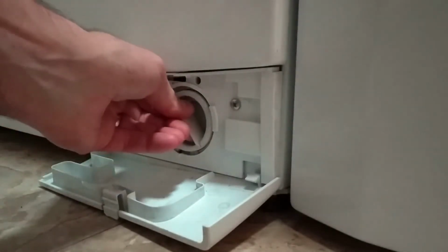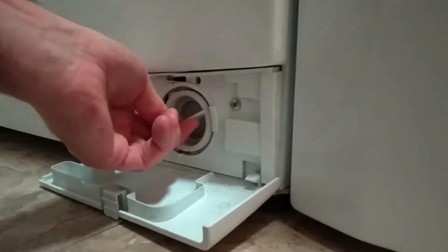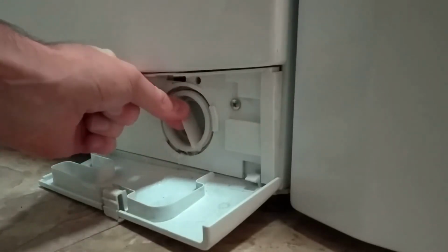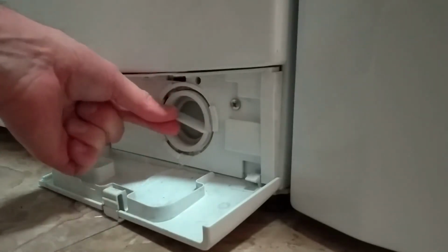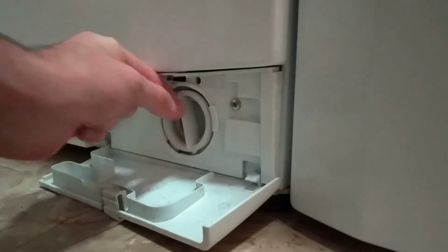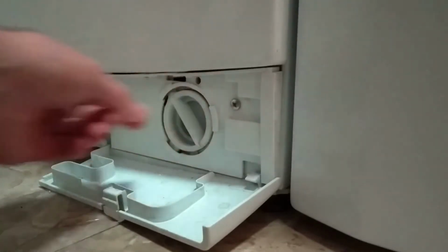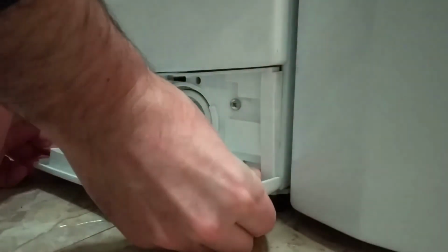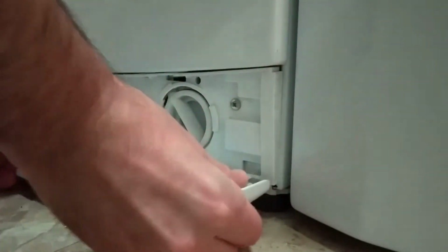The next thing to do is to unscrew the drain filter. Do this fairly slowly as there can be quite a lot of water behind it in a clogged system. You may need to empty the draining plate a couple of times. You can now see why the attached door is no good at all. So I'm going to unclip it and replace it with a slightly larger one.